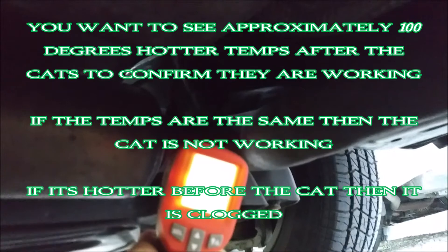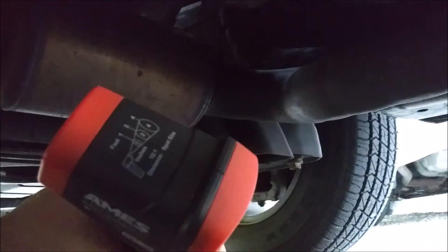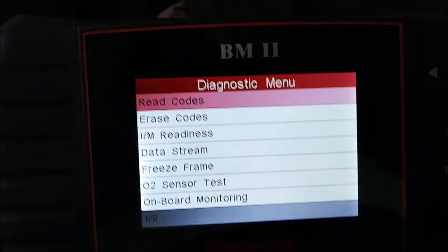About 100 degrees difference - I'd say it's working. I would say maybe the O2 sensor is just getting a little dirty and not working as well, or you could do that cheater device and put it in there like I did on my Crown Vic and not have to worry about it. That's probably what I'm going to recommend, but I'll also show what it would look like on a scan tool - the oxygen sensor data you're looking for.